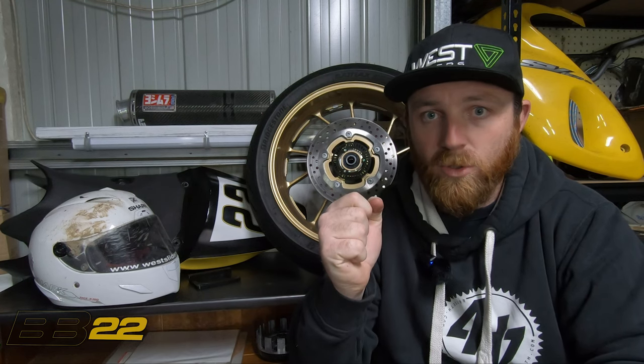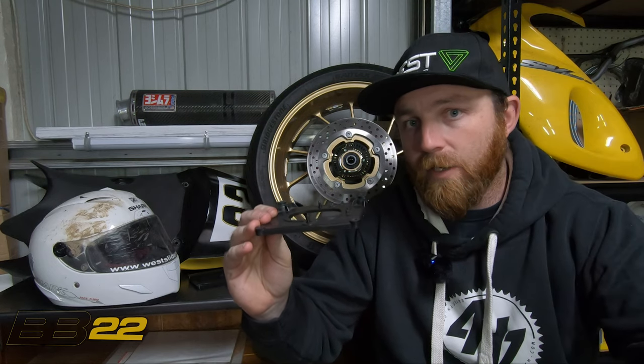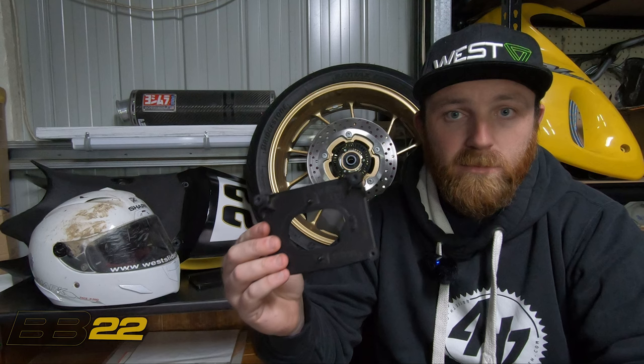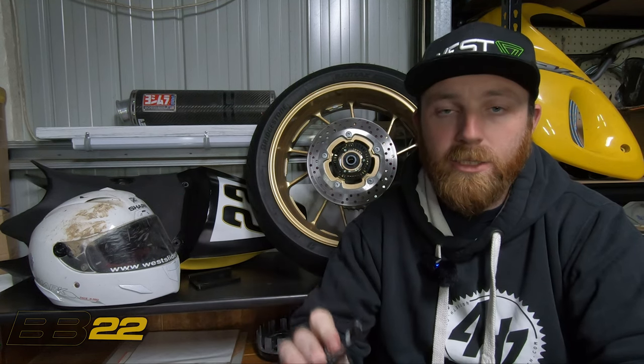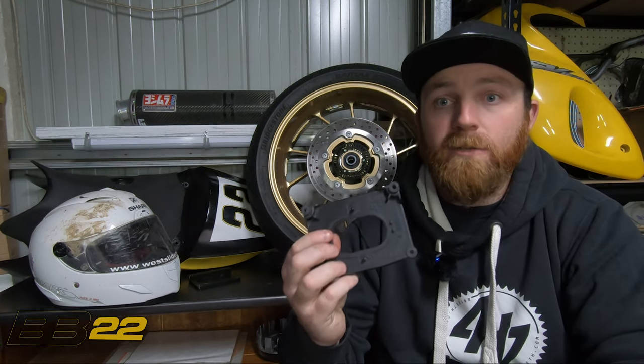That was literally just pull the snorkel, run the bike on the dyno, and see what changes with the stock mapping — we didn't fuel it, we didn't do anything. Then we swapped the standard air filter out for the DNA air filter. With the stock lid on the airbox we had no change — it was ostensibly the same, maybe 0.01 horsepower change throughout the rev range, absolutely zero. So it looks like the lid is the limiting factor.